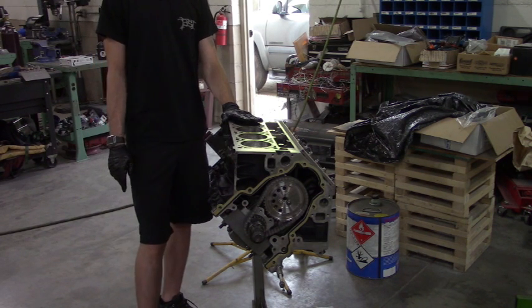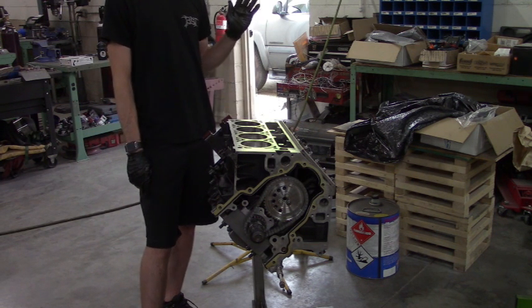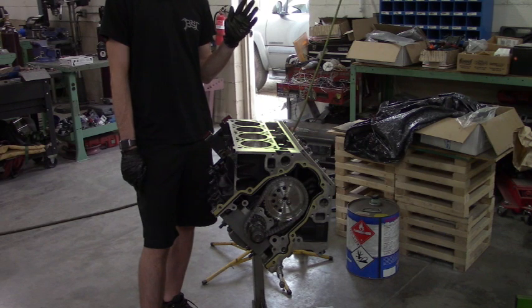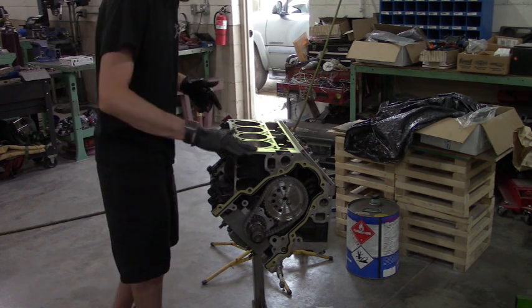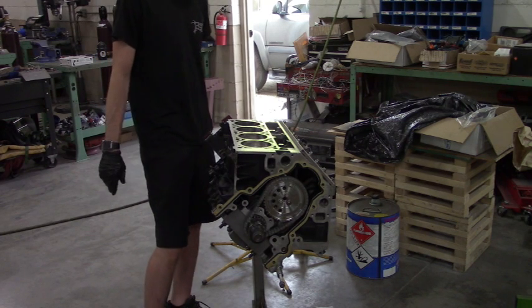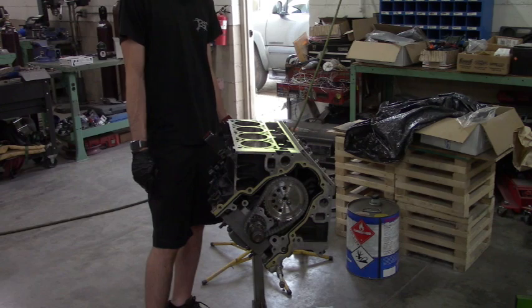So once again, none of them had anything you could feel, but you can see a little wear in the coating. And this thing does have some issues on decel. When the chute comes out, it does slosh away from the pickup, so that probably doesn't help as well. But overall, it looks good. The car always has good oil pressure, so I'm not really worried. Just figured some simple things while I'm here, and I had some on the shelf.